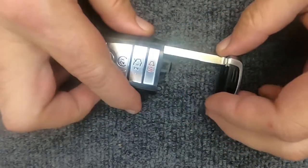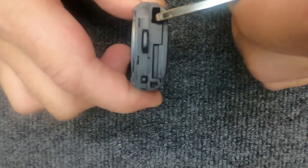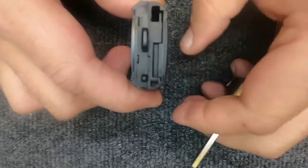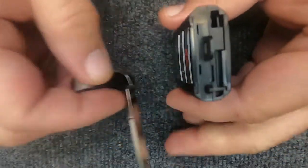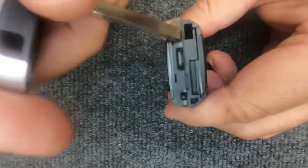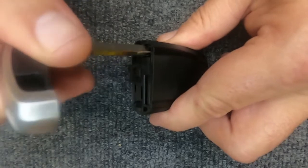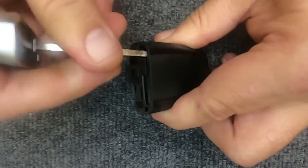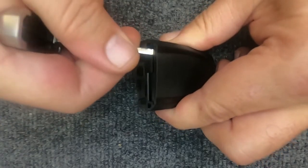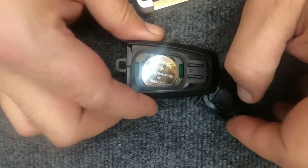The remote will come apart. When it does, you'll see where the emergency key was, and then this flat spot. I'm going to insert the key blade in the emergency spot — only about an eighth of an inch — then rotate it and you'll see the corner pop up. Once that corner pops up, take your emergency key, push it up, and the back opens.